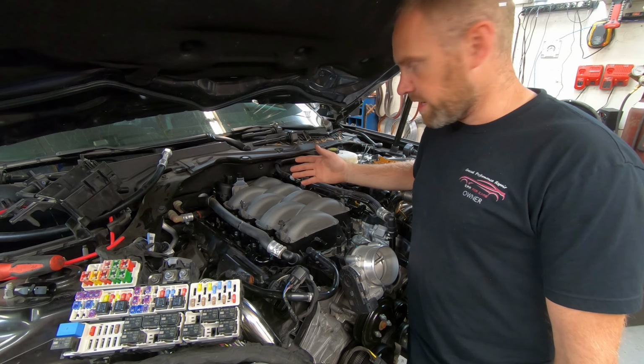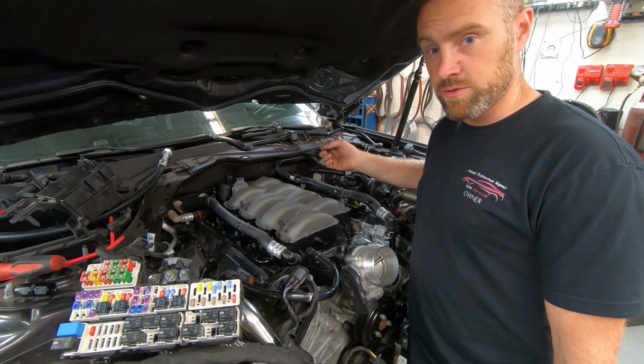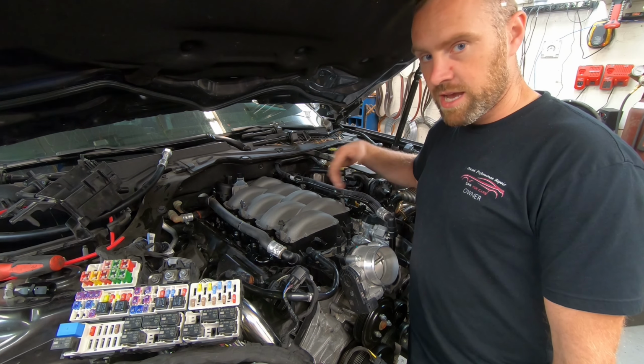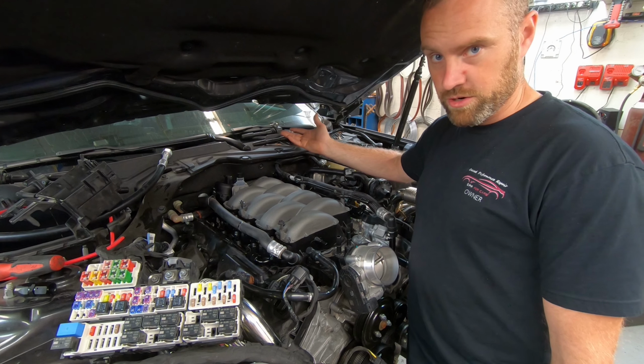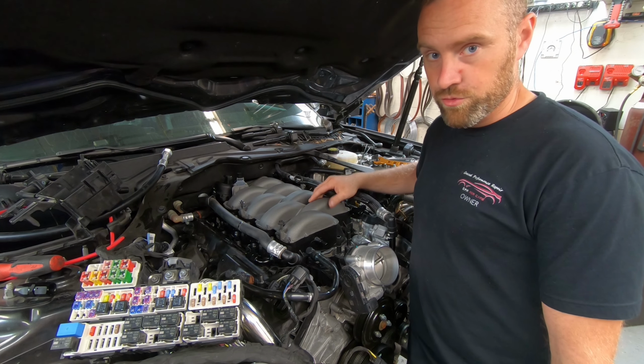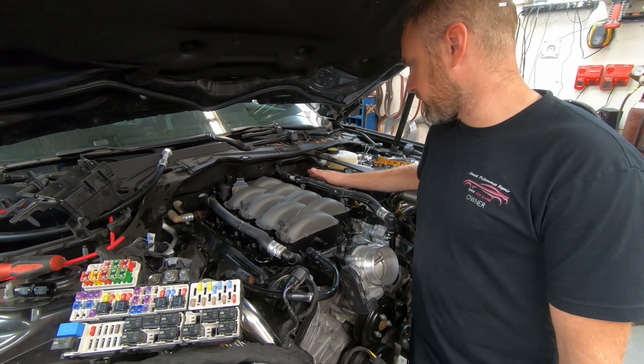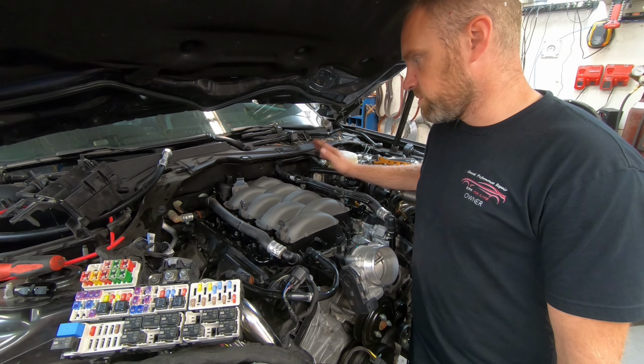And if it needs to be upgraded later, it can, because that dash can be put into a dual 8 splitter. And then at the tank side, if he needs to add more fuel there, you could put a splitter down there too without having to go through a ton of work. So upgradable later, but good for me to do the On3 thing.